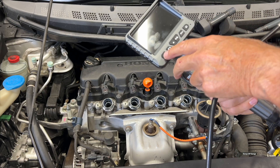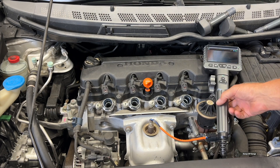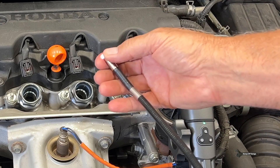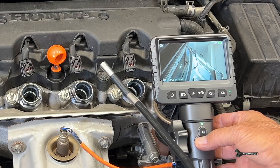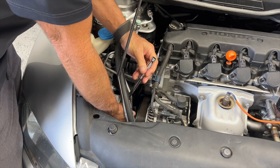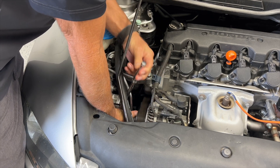So here's the borescope. I'm just gonna turn it on, and then kinda wedge it somewhere where I can see the display. So I'm gonna take the camera and shove it down the cylinder — I want to make sure it's recording. So we're going right down the cylinder here. There we go, we're right in the cylinder. Let me see if I can get that piston down a little bit further. I'm gonna just use the alternator pulley. The plugs are out so it's not gonna be a problem. Let's pull that piston down a little bit further so we can see the whole area.